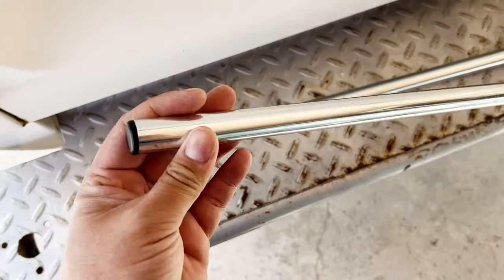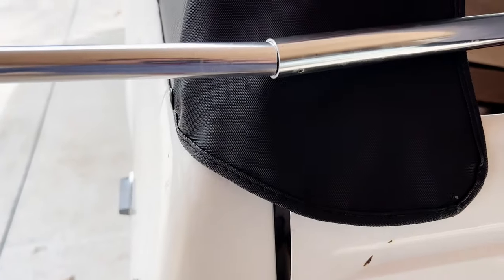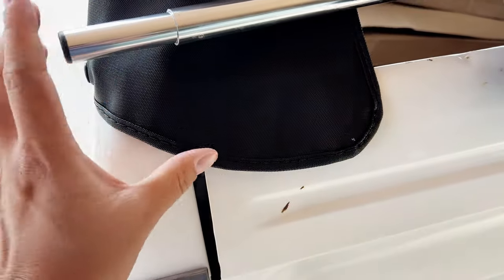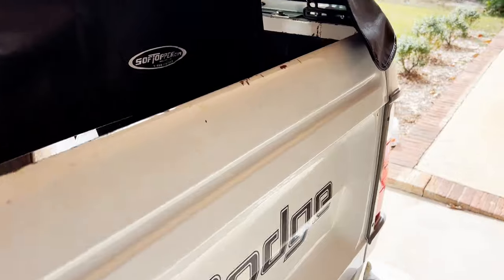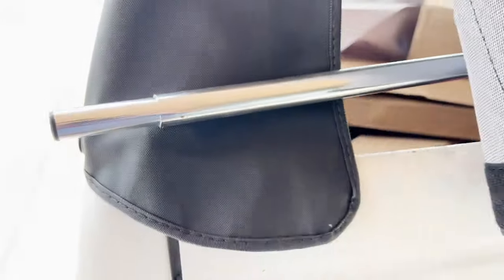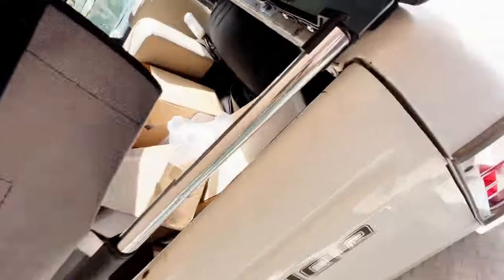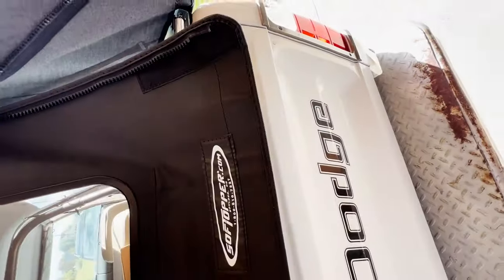You see that metal bar goes in there, and that sleeve. There are these two end pieces and the two self-tapping screws that we saved from a long time ago. So this goes in here, and I guess we'll adjust it left and right so that it snaps in that bracket. It's on each side. And then use the screw to lock it in place with that pre-drilled hole there. And then you pull the flap down and snap it in. As such, so now I need to add the screws into the respective holes. And that should be that.